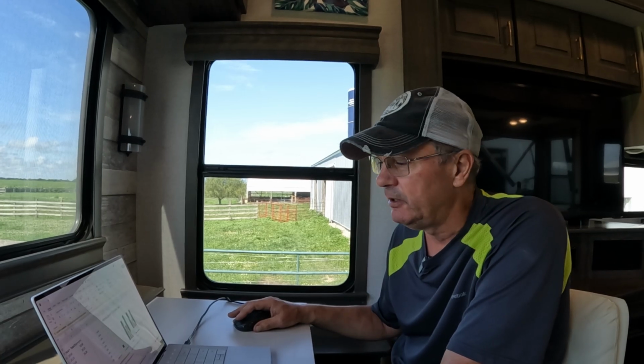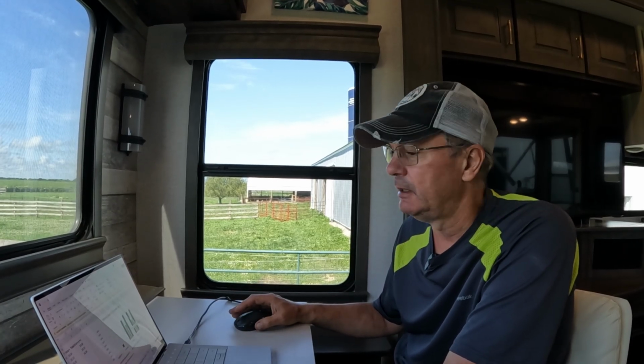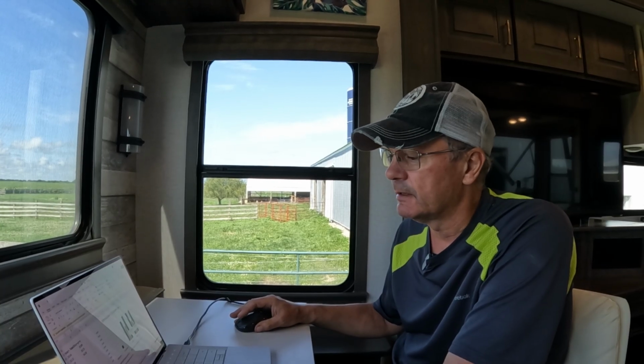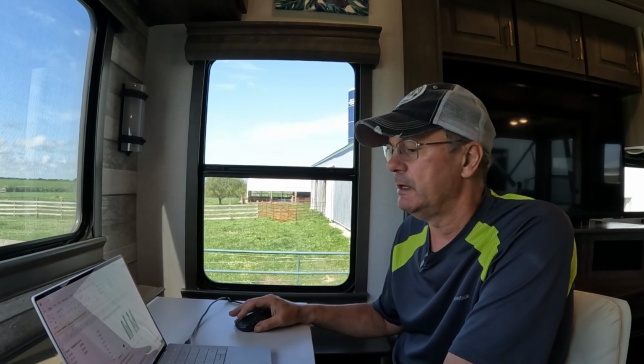So this may suggest that one, having the proper spring size for the weight of your trailer is important, which would be maybe a little obvious, but it may also suggest that the 6K springs are really performing a lot better. The reason I use the word suggests is in our testing, we had basically 20 miles of highway testing, and when we start looking at the total G forces over half a G, there aren't a lot of data points. So not having a lot of data points in that range lowers the statistical probability that the data is valid and very important.